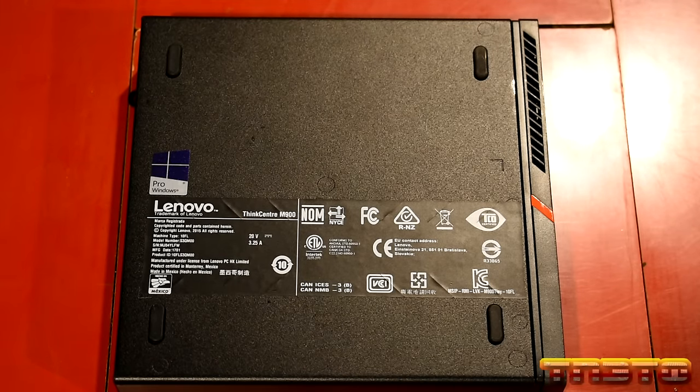What you'll do is you'll go over to Details, and you're going to get the hardware ID, copy it, and paste it to a text document, and you're going to search it later, figure out what device it is. Okay? That's the easiest way to find out what this device is that needs the driver.